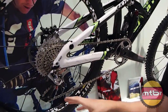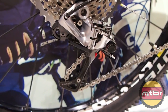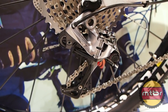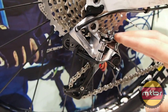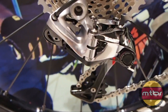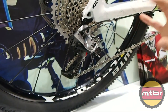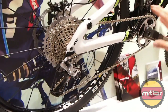Moving down to the rear derailleur, a lot of the magic is happening in the chain management system. We have our Type 2 clutch system on this, just like the X9 and XO rear derailleurs of this year. We've also changed this whole piece — we went to a straight parallelogram, which came out of our German development facility. They really brought some cool pieces to the table to manage that chain across that wide spread. With the straight parallelogram, you get no movement, and that's really where some shifting confusion can happen with big impacts.